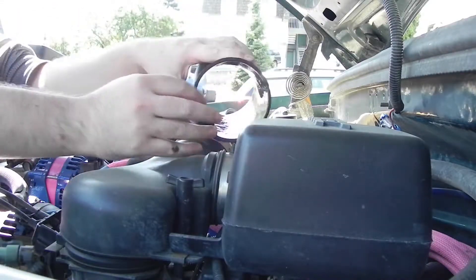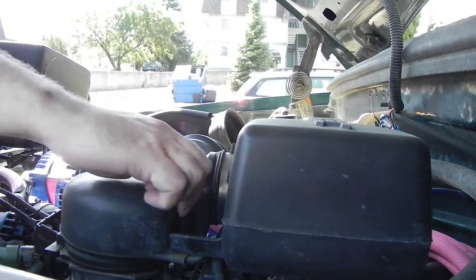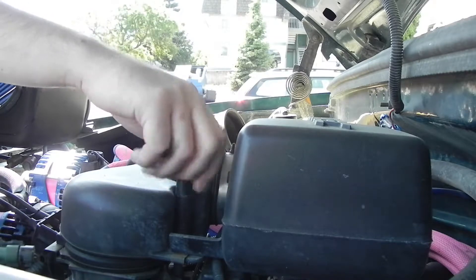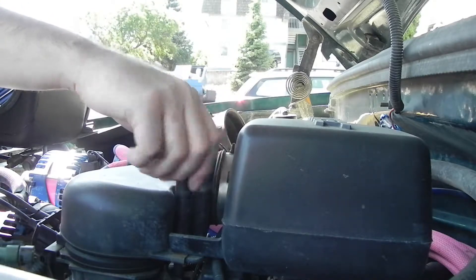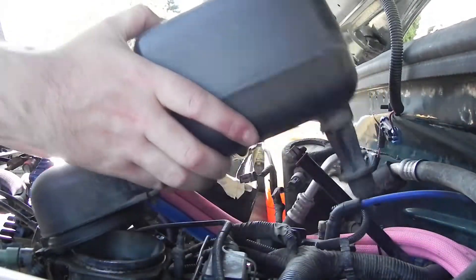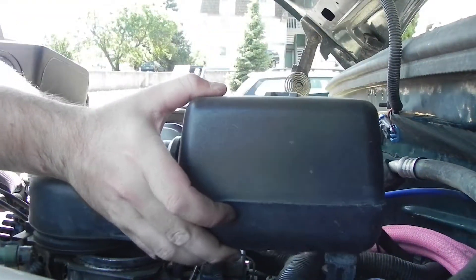You can see it's just a little connector sticking through the back side. Now I'm removing the bolt on the back of the intake — this is the only thing that actually holds on the stock intake. It's like a little wing nut plastic piece. Then you just take off the rest of the intake; it has like two little clips. You pull up the back, then pull it toward the front of the car and it comes right off.